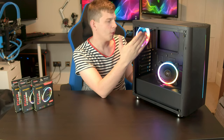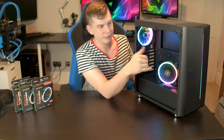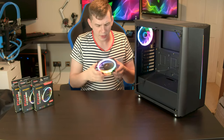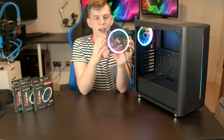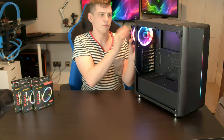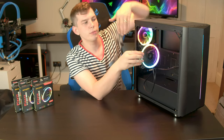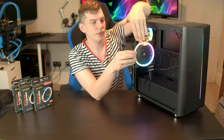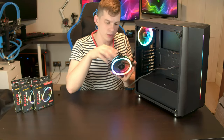Should you add some extra intake fans - the only fan included is the 'Pirate Turbo' fan as they call it on the back - I would maybe put a couple of these in. They sent me over three of their Duo Ring fans, which I think would suit the inside of this very well because they have rings on the front and back. If they're on the back of your case you'll get some rearward illumination, but if mounted on the front as intakes - with a clear plastic or tempered front panel - the back ring will illuminate the inside of the case quite well.